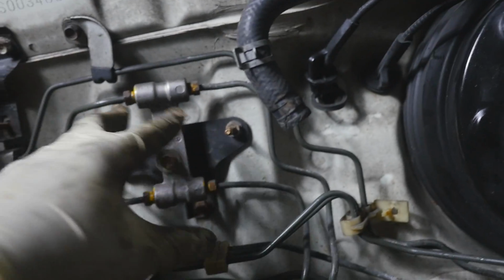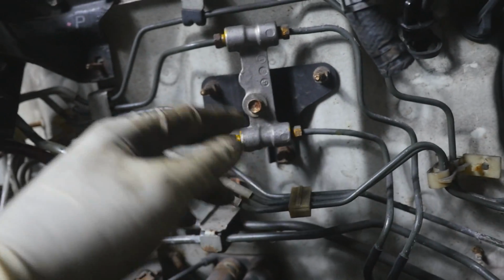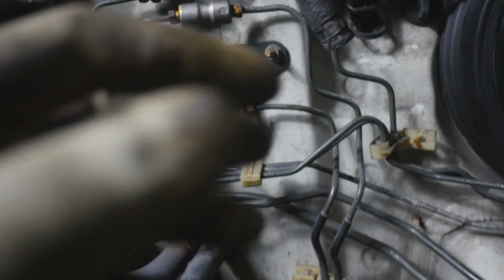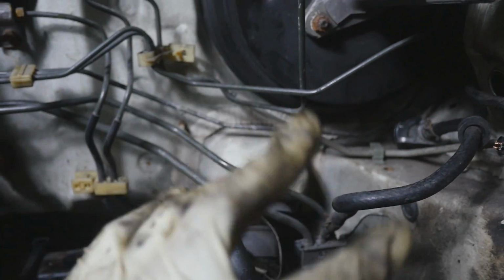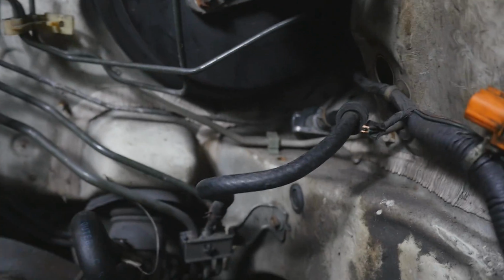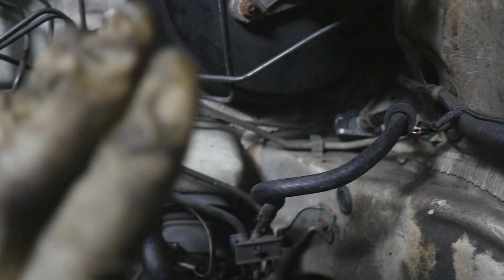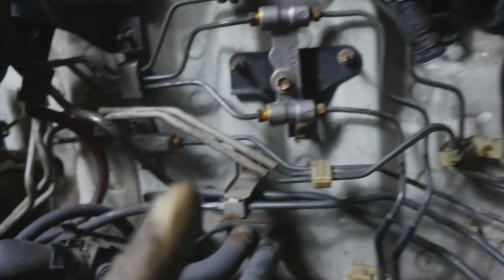And then once we get over here, once all of this is kind of free, we can start to take off the prop valve and actually just take off all of these fittings and then slowly pry it up, work our way over here, and then slowly pry it back. And then once we get over here, which is pretty much the home stretch, it all comes out. And then your life is just so much easier after we get all these lines out, because these lines are just terrible. Okay, back to what I was doing. I'll be back.